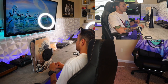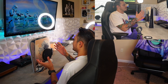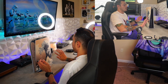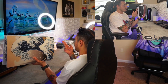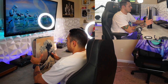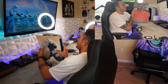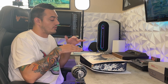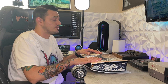First thing you need to do is remove your stand — it is mandatory that you use the stand. If you have the console horizontal in your entertainment center, it's held on by friction and you can just snap it off. If you have it in vertical orientation, there's a screw under there with a flat tip. The side panel you're going to pop off to get to the NVMe SSD slot is the side without the PlayStation logo.